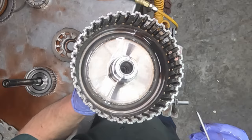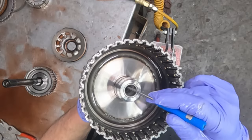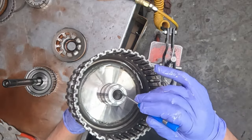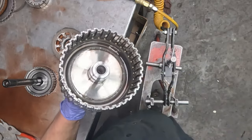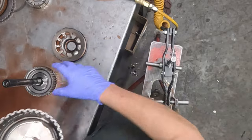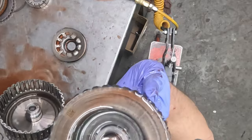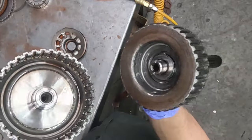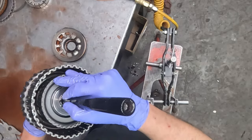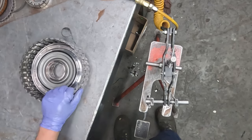Another thing to pay attention to on the 4.56 drum is the little bushing that's in here. And that bushing, not only does it help keep the shafts and other drums in a centerline axis, it also acts to seal in compensator feed oil. And we test it with, as you can see, this is the pilot that goes into that bushing, and this is in good shape. It's really not going to get any better than that, even with a new bushing.